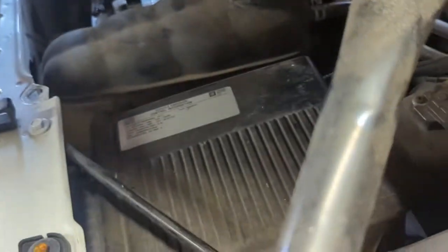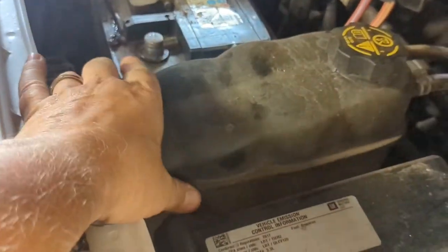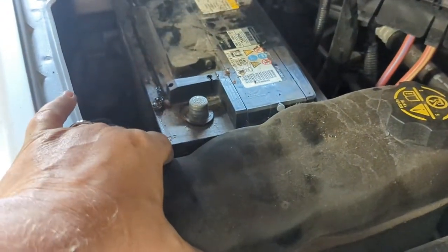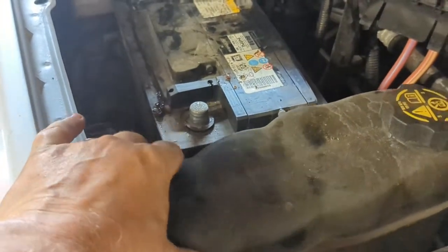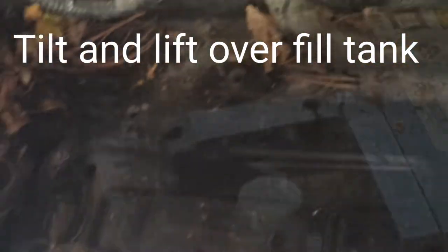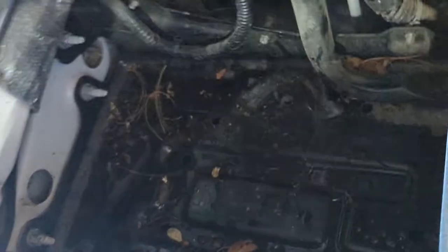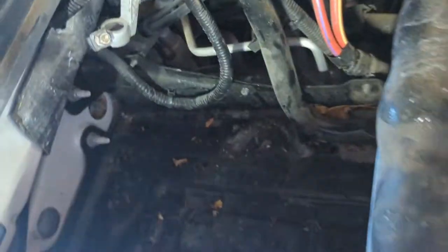This bar comes out first. I removed the two terminal posts with 10mm. 13mm here, 13mm there — it's laying to the side. I pulled the tank back just a hair. It has this post that's mounted to the frame. You can move this back off that post so you don't run the risk of breaking that little tab. It's loose right now. I'm gonna take that out and we'll put the new battery in. One battery tray — a little bit of leaves and stuff in there. Clean it out while I'm in here. A relatively new truck, considering.